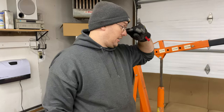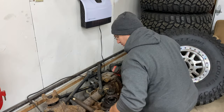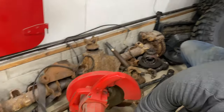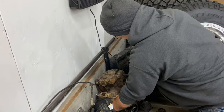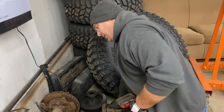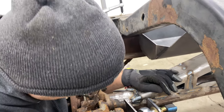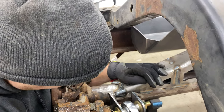Before we get those things placed, we've got to make sure they fit with the calipers on. So I'm taking the old calipers off of our spare 14 bolt. We know that it fits. Got the calipers on - now we're just going to make sure everything still fits. Do you see what I'm seeing? We're not going to be able to get our bolt in there while the calipers are on. And it's angled towards that tube, so we don't know if we'd have enough room to get it in there.